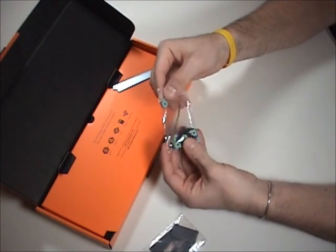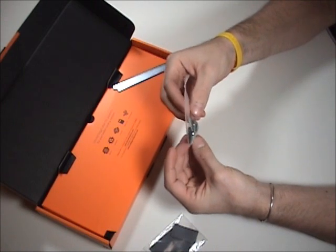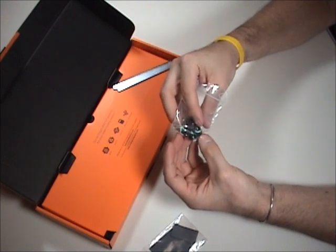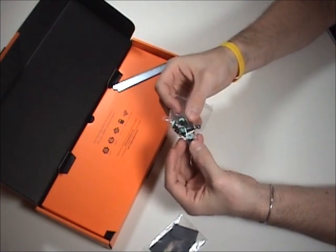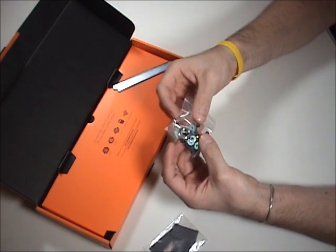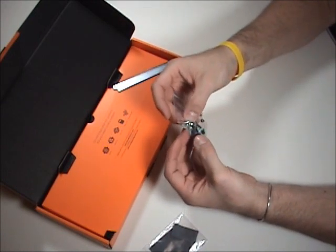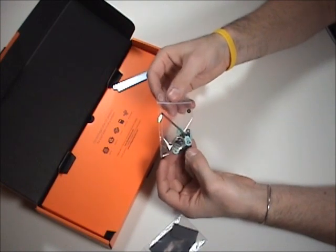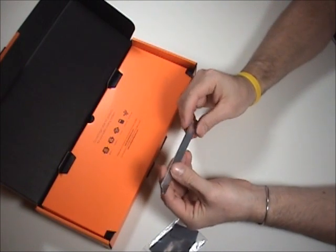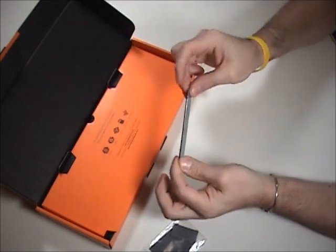It's a little hardware bag. Here are the little paper washers — I believe these are for the screws so that they don't damage the motherboard when you mount it. There are also some standoffs here; these little plastic rings are to cover the gaps between the board and the water block when you mount it. And they include an Allen screw as well. Here's a bracket to go on the bottom of the motherboard — so this goes under the motherboard, water block goes on top, and then your screws go through this.